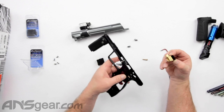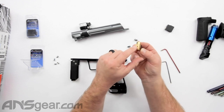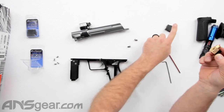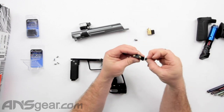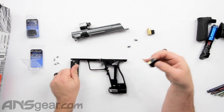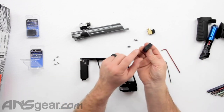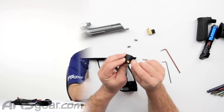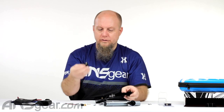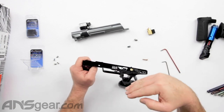Grab the original valve and pop it out. Sometimes when you pull the valve out, the gasket on the bottom will come out with it — if it does, take that one out and put it into the new one. The top one stayed in here, so we need to take the top one out and put it into the new one. You can't get this backwards because one side gasket is oval and the other side is shaped almost like a teardrop or pear — that oblong shape. So you can't flip this around and get it backwards or upside down.